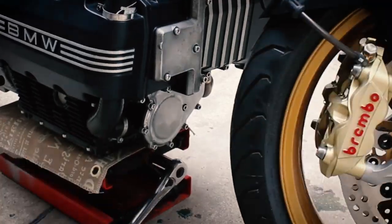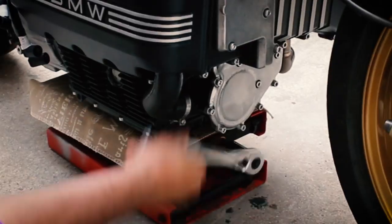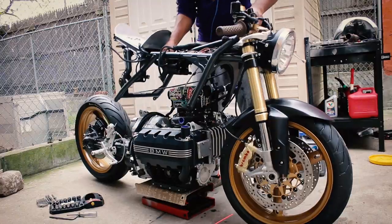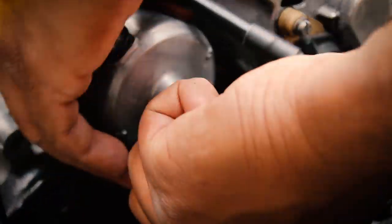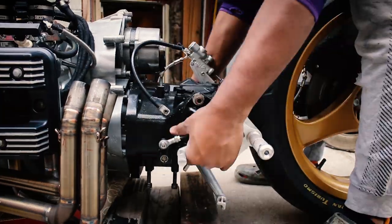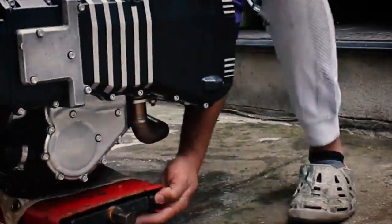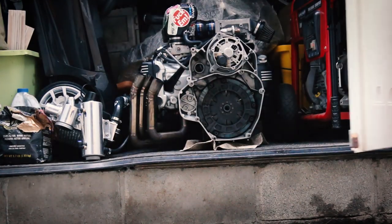The next day I tore the bike down one last time to prepare to move it out onto the road. I discovered that I put way too much lube on the clutch splines and flung it everywhere, most likely contaminating the clutch. Also something at the bell housing was leaking oil — either the rear main seal or the output shaft o-ring. I could have said screw it and slapped the bike together, but I decided to do things right. Also, my brick was experiencing that common issue of the starter sprags not engaging the crankshaft, which makes the starter spin independently of the engine. So I left the engine in the shed and the rest of the bike in the basement, adding that to my reassembly checklist.